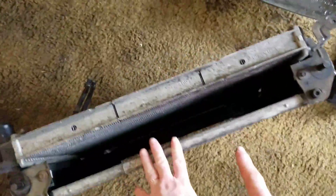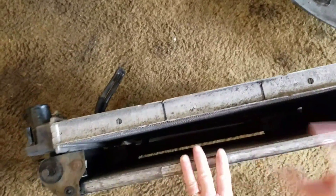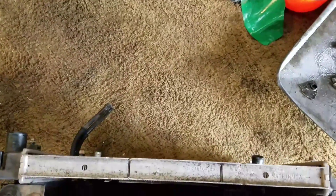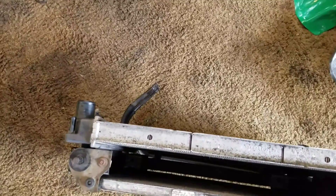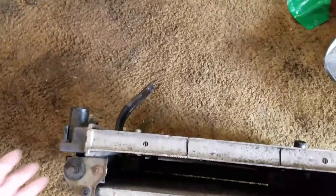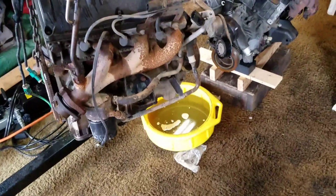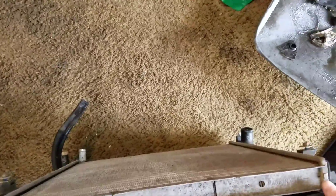I was able to get the radiator out without taking all this out, but it was a pain in the butt. This way is 10 times easier, especially if you have air conditioning equipment to evac the freon out. That's the way it's going to go in and go out, particularly if you're trying to pull out a motor. Taking this radiator out with all these things gives you a ton of room to pull the engine forward to clear the firewall and the cowling.